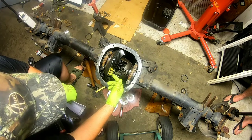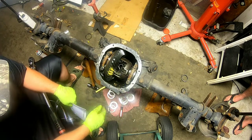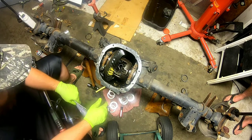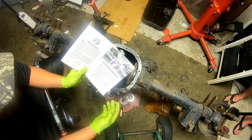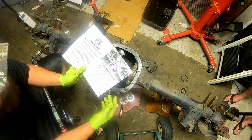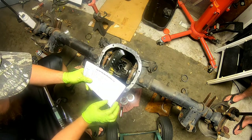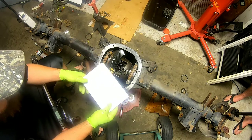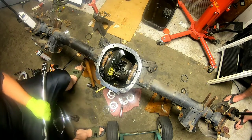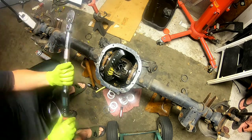That's really nice — how much better it rolls when everything's nice and tight. It's almost hard to get a backlash reading because it's so smooth now. That's back where it was — that's what we wanted. I'll grab my torque wrench and torque these down properly. I believe it's 60 or 65 — I'll have to check real quick. I'll throw some paint on it and check the pattern. There isn't really anything we can do about it because we didn't change the pinion depth shim and we set the backlash back where it was, but it doesn't hurt to run the pattern and see what it looks like. This is Yukon's gear marking compound — I run a lot of Yukon bearing kits and this comes with their kit. It says Ford 8.8 ring gear bolts and main cap bolt: 60 ft-lbs.